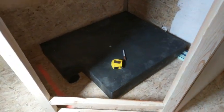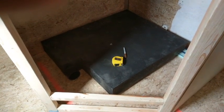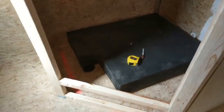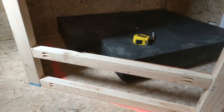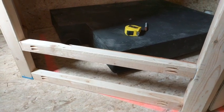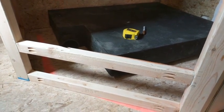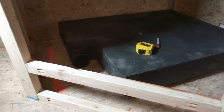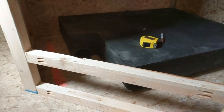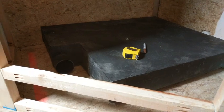You can see that's the black water tank right here. I don't want it underneath the camper because it sticks down too far and I'm afraid I'll catch it on a curb someday. So I wanted to put it down here on top of the floor — it's gonna be a lot better supported. I don't have to worry about straps rusting off like you see on pre-made ones. The floor will just go on top of that, and I'm going to run some structural plywood joists over it.